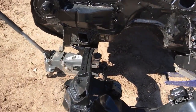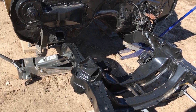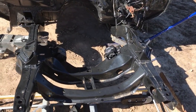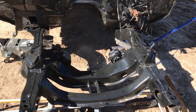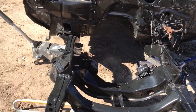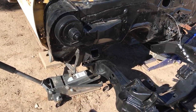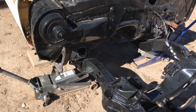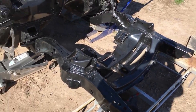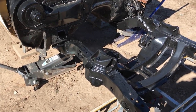I did go ahead and stick with rubber bushings in the control arms because I kind of want those to move a little bit and not have a bunch of road noise coming through the chassis, but at the same time I still wanted to have the car stiff. So that's what I did on that. When we come back I'll have the two back bolts in and we'll probably have this squared up and straight and have the subframe actually supporting the car again.